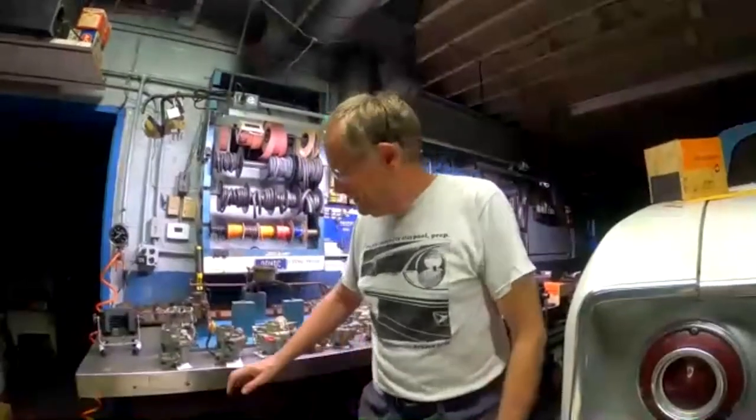So I've not seen that. I've seen carburetors that somebody forgot to put it in, or they put in the wrong part. They put in a discharge needle instead, which was worthless. And when you leave it out, boy, you get bad gas mileage. So I've never seen the passageway plugged up. Okay. How about, I'm sure it's happened somewhere.